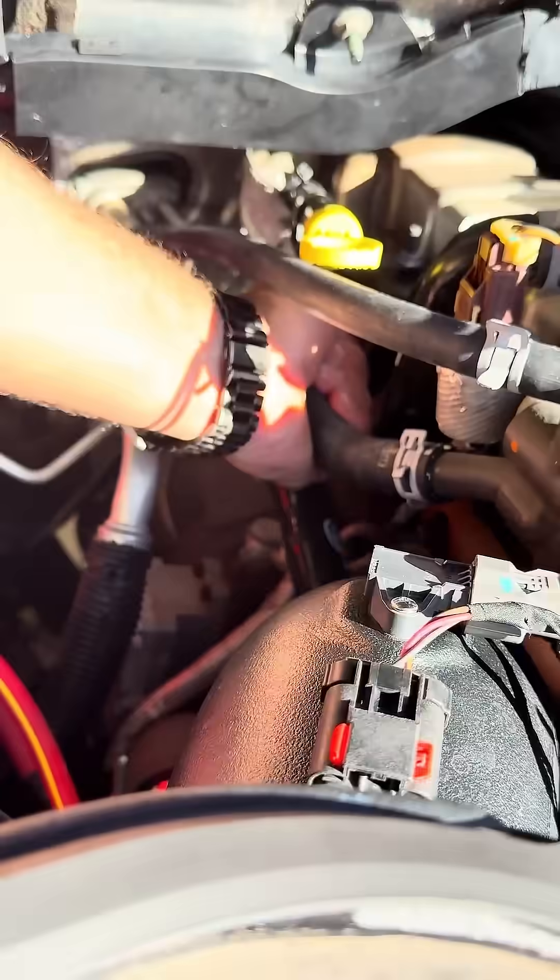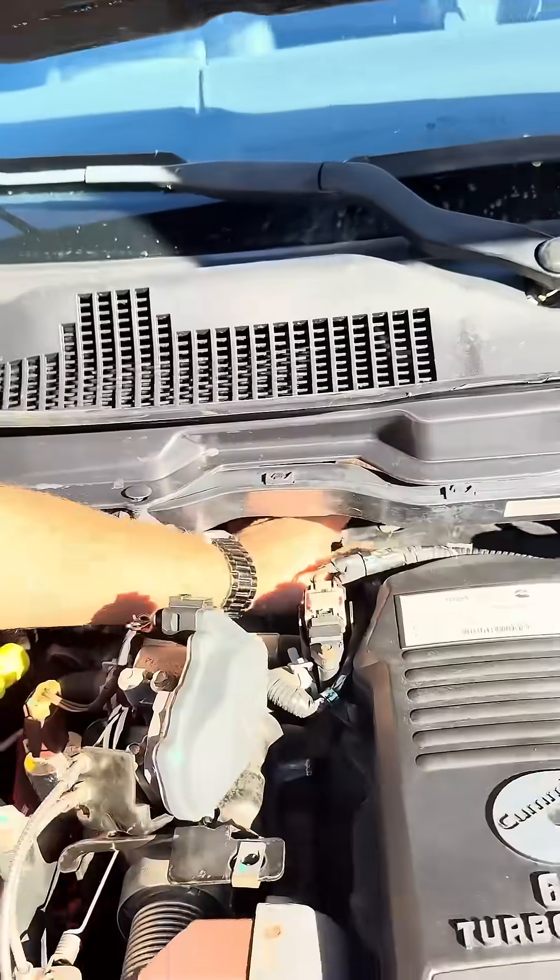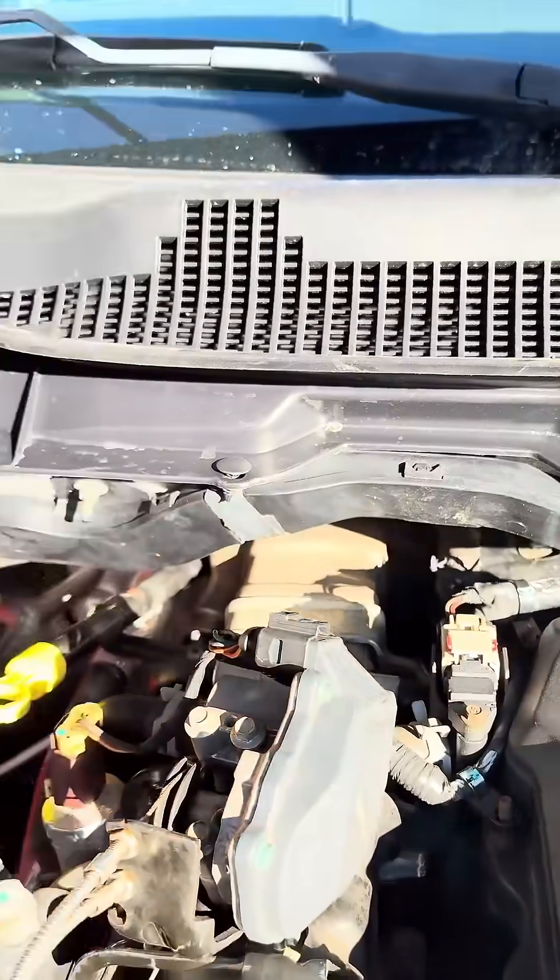We test drove it and it's going kind of cool out of here. I'll go check the heater hoses — I can keep my hand in here, it's just warm. But on this one, yeah, that one is hot. Hard to believe that a truck guy didn't know he had a plugged heater core, but let's pull the hose off and flush it.